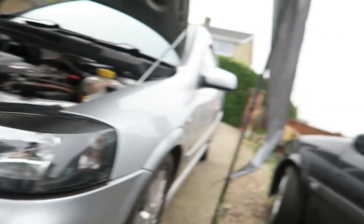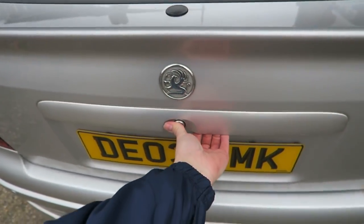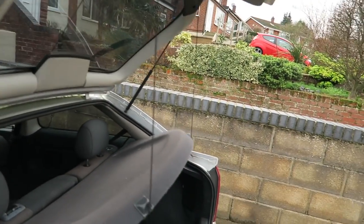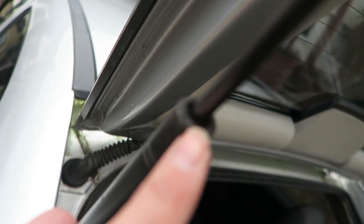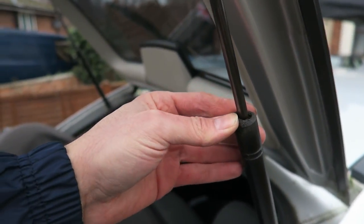As I said at the start, the main job was the bonnet struts, but that wasn't the only job. The boot struts on the Astra are really weak. When I open the boot — even when it gets to about this high — look at that gap, it just falls. The struts are pretty much doing nothing. It's only when you get it really high up that it does anything, and anything below that just falls — I'm not even touching it. I need to take these off and replace them. You can see there's a bunch of residue around here where they've obviously been leaking oil for a while, so we'll get these changed out.